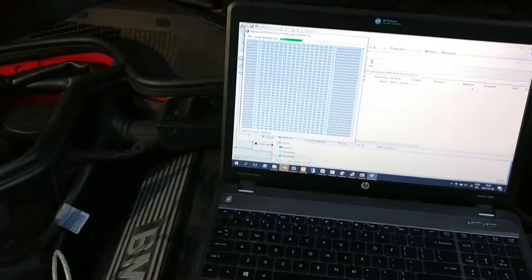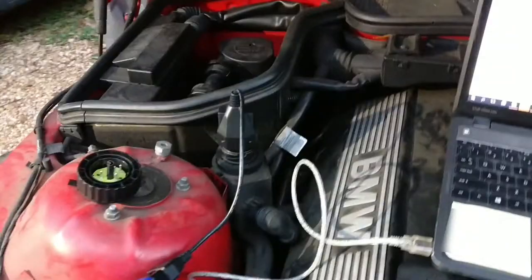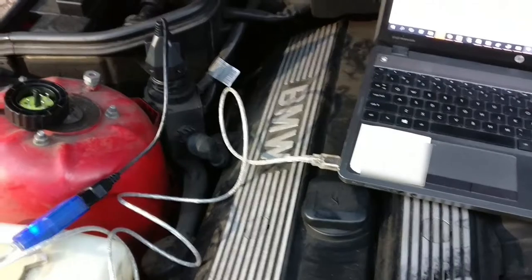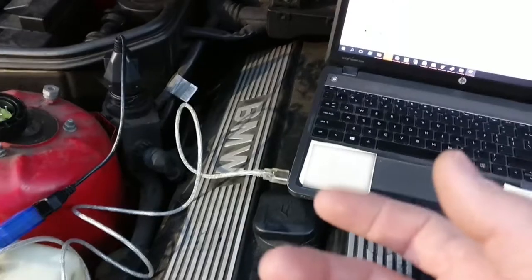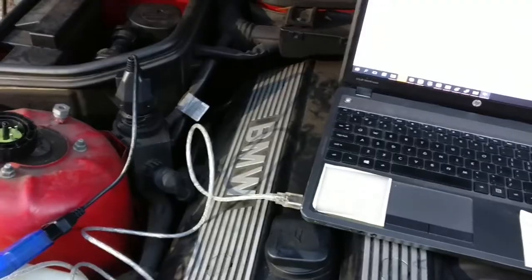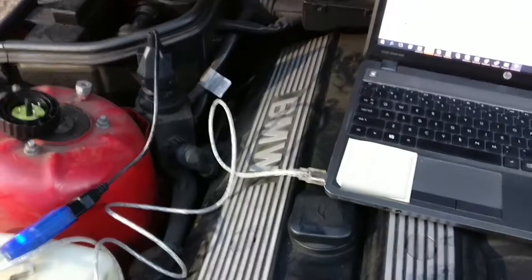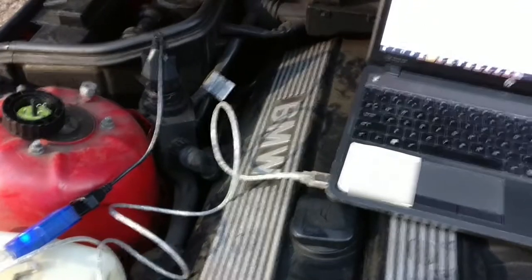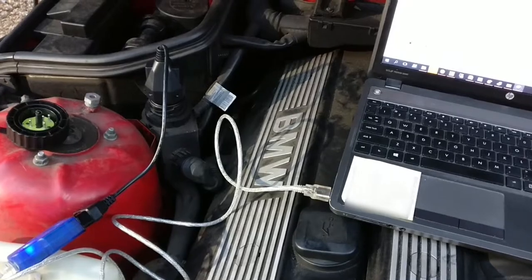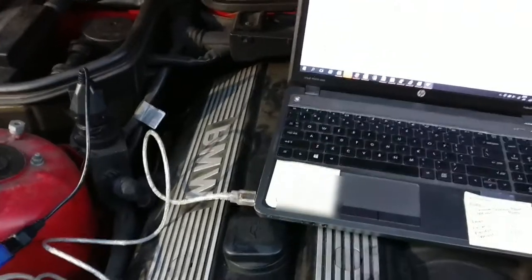So in the event that the unthinkable happens and I do screw something up, I will. Notwithstanding completely bricking the EEPROM, which is the memory hard drive, where all the firmware sits on the ECU, which theoretically I can recover from, I will have a good backup to flash back onto the ECU.